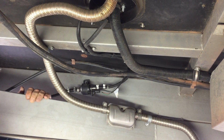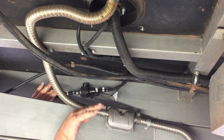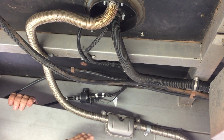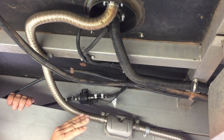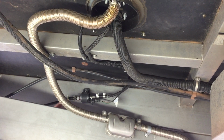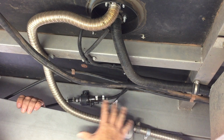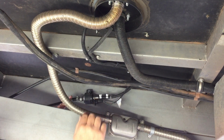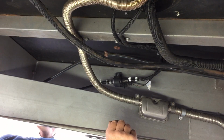Now, a little bit about that fuel pump. When you're installing it, you want to make sure you've got it at an angle, because it's set to control at a metered rate, and therefore you're going to make sure that you're never going to have air in the system. So at the angle. The other thing is, if I just wiggle it, see how well it's rubber mounted? One of the issues a lot of people complain about diesel is the noise and the ticking. If you rubber mount everything, you're not going to get that situation. So therefore the line then runs back up into our tank.